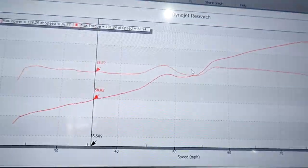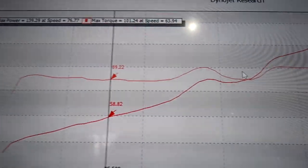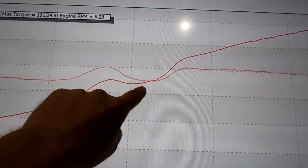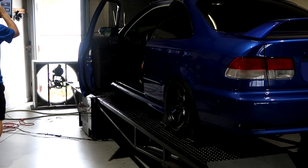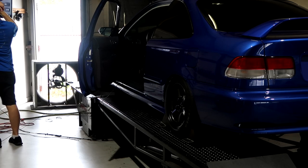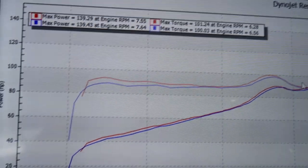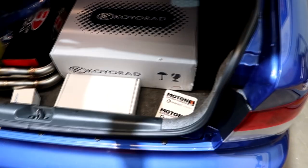See where we are here - 139 horsepower and 101 torque. I'll change it to RPM so you can see it, but you can see how the low cam kind of falls off and the high cam comes in. All right, it's back to pretty much the same - 139 and a hundred.